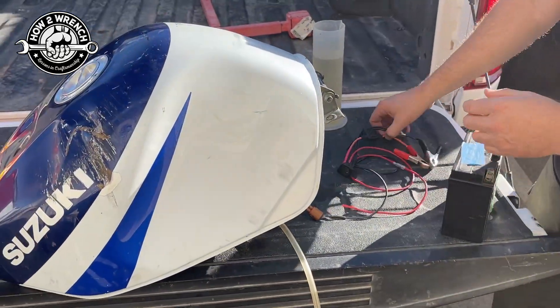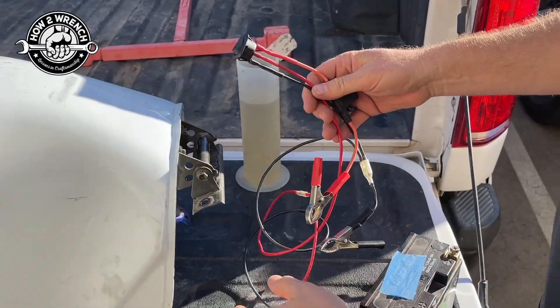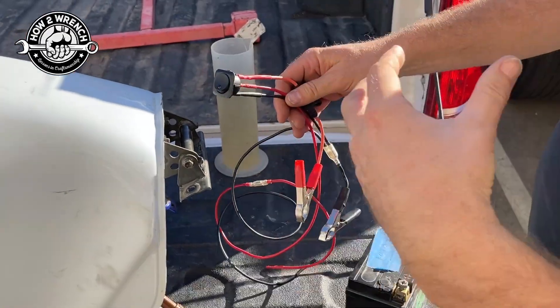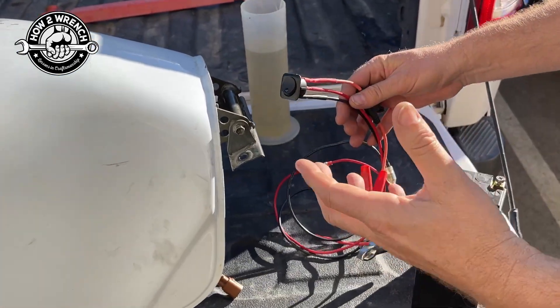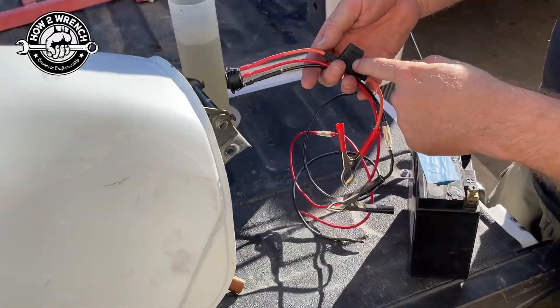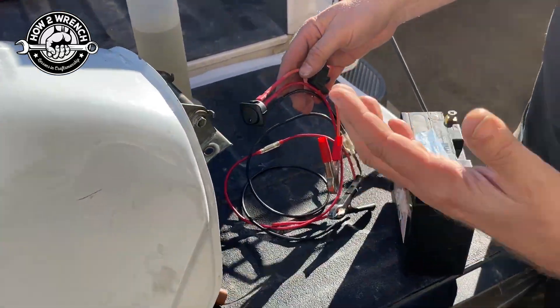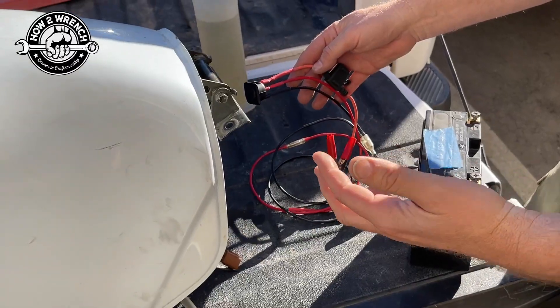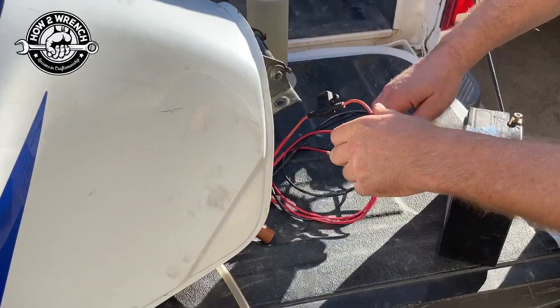So let's look at the tool. We know this is a 12-volt system, so what I did is I just pre-made up this cool little rig here. I was overcomplicating it putting relays and all that, and figured I don't need that just to test a pump or a fan quickly. What I really need to do is controllably and safely put 12 volts to something so we don't have any problems - especially around fuel, we don't want any sparks. Cool little switch with an LED so I can tell whether it's hot or not.